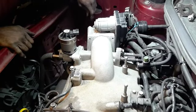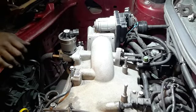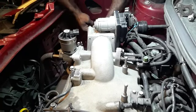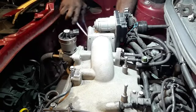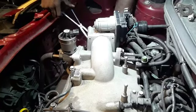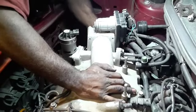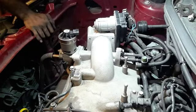So pull the hose off the tube here. I'm not gonna worry about where they go because they only fit one spot. This tube, this heater hose, under the intake, under the throttle body, sorry. So that's sitting, this should be loose. When I put the intake down, hopefully I'm able to rest it on there. Take the alternator bolt, should be a 15.